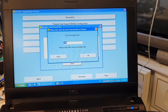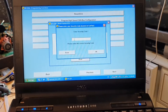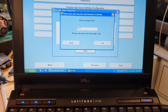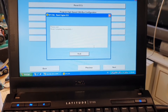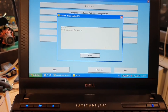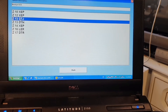Remember the pin code — ignore the four-seven-one-eight, that's for some other modules. The pin for this car is 9850. I'm going to perform the reset now. It tells me once this is done I won't be able to start the car, and — reset completed successfully. It actually didn't give me the warning, but reset completed successfully.